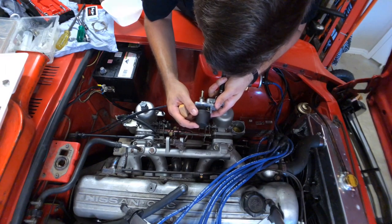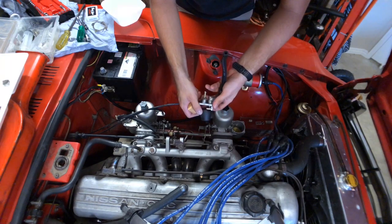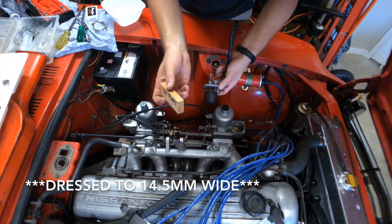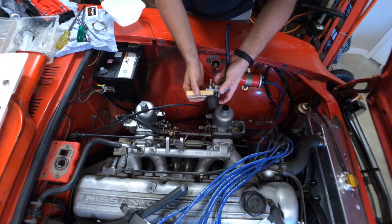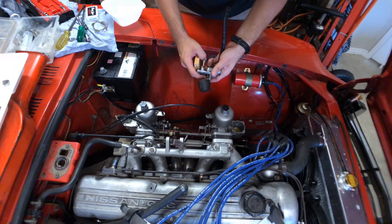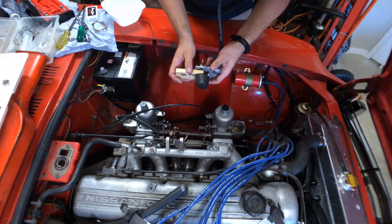I don't know if you could hear that, but you could hear it stop operation. As I said, I've got mine set so the float operates at a higher level, lifting the fuel up in the nozzle and enriching it. What I have here is just a depth gauge I made. The general rule is the fuel float should be flat and just touching the nozzle. It's always good to check the actual operation once you've adjusted it, rather than just putting a measurement in. So I'll go about adjusting this now.